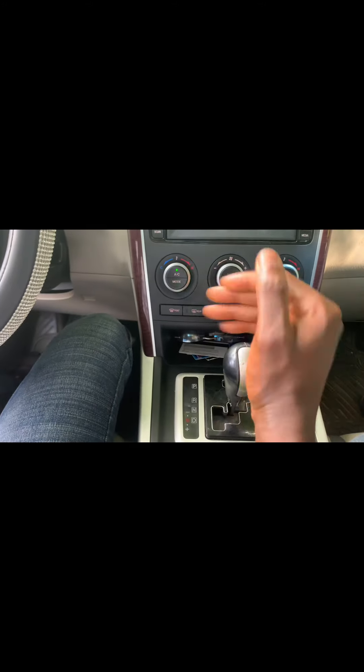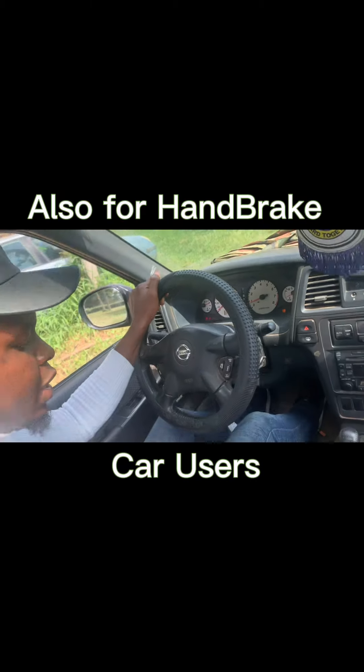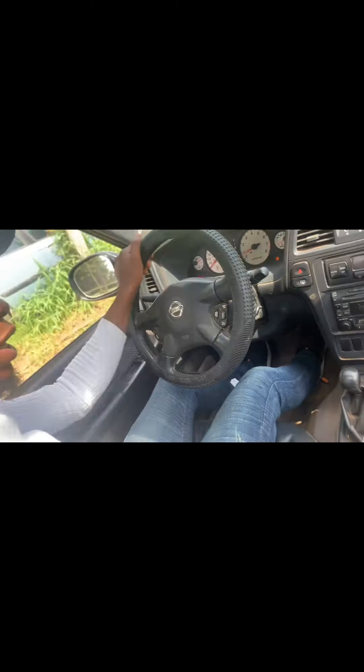Now the question is: how do I park my car rightly? How do I park my car correctly? Come along and let me show you. When you get to where you are stopping, press your brake and then push the shifter to neutral. After doing that, press your emergency brake or parking brake very well. I move my leg from the brake and the car is still — it is not moving forward. That means the car is already resting on my parking brake. Then I put my car in park. This is the best way of parking your car.